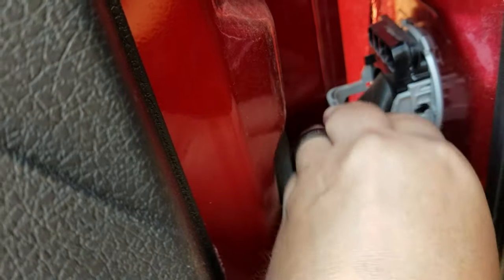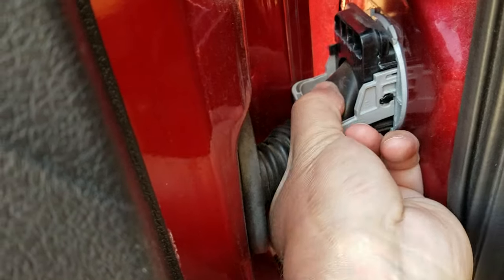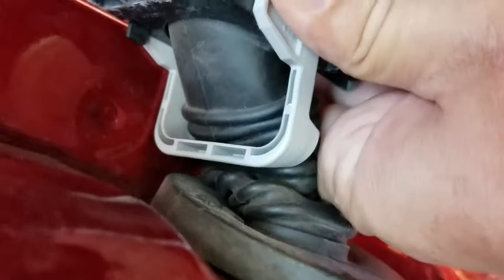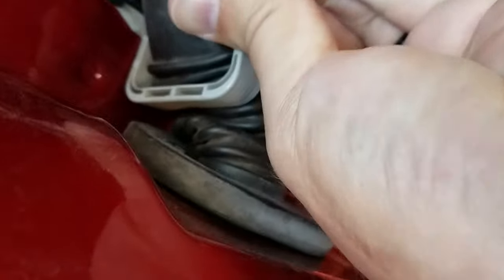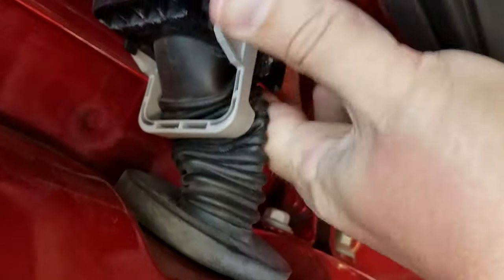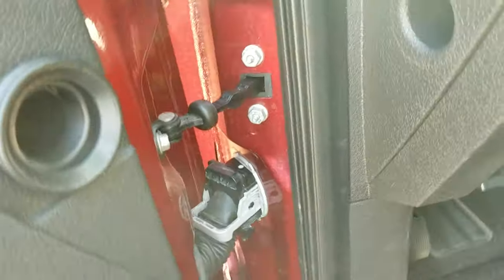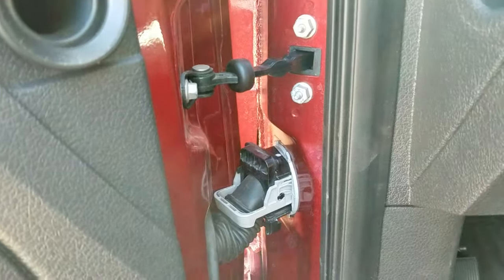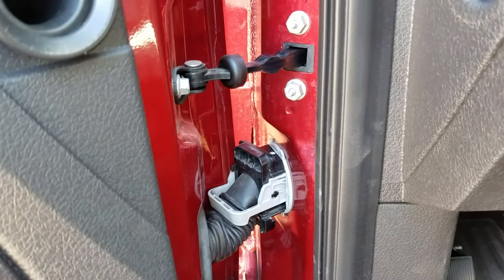This was probably the most tricky part for people. What I did was drill out some holes on this piece here and then ran the wires through to the inside of the body of the truck — through the wiring loom and into the body so everything is sealed. You don't want a half-assed job where you've got wires hanging out, crossing from here to here, and being folded underneath the seal. That's bad for resale value and eventually the wires will be pinched so many times that they'll short out.